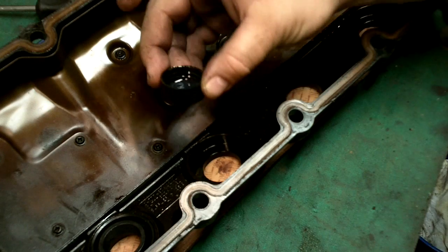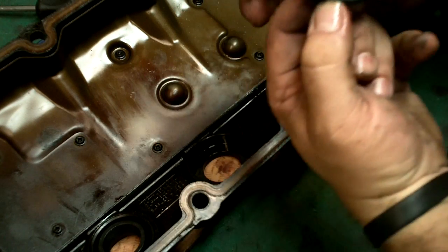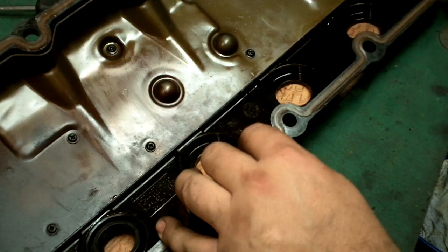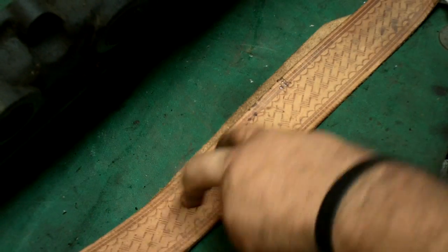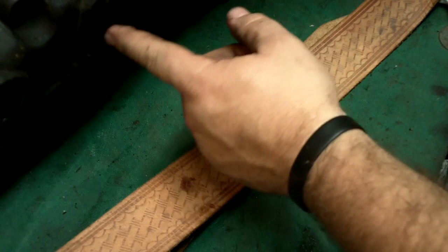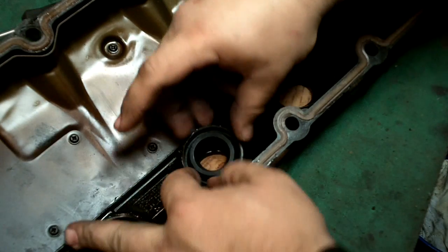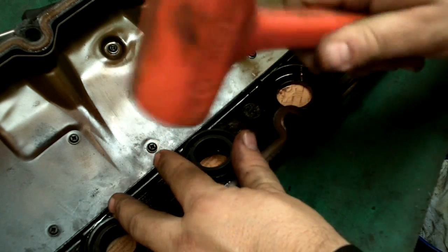Put a little bit of motor oil in the cap and rub it around the seal. Now to put it in you have to kind of hammer it in. I've got a leather belt doubled over underneath here because there's a lip on the outside - I don't want to mess it up. So I take my dead blow hammer - it's got sand in it.